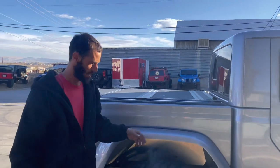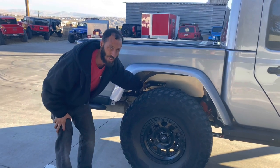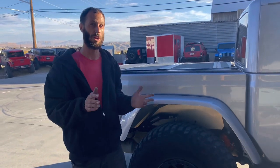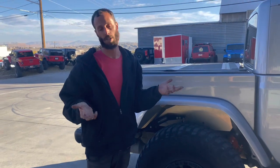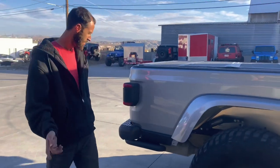Re-fixing that geometry helps keep the axle in a better line — both vertically and in how it handles potholes and bumps, so it rides well. Again with the 39s you can see the highline fender and the aluminum inner fenders. You also have what's called the Anti-Rock rear sway bar. In the front, the Rubicon in four-low lets you disconnect the sway bar — if you had no sway bars the vehicle would roll a lot. The Anti-Rock adds a little stiffness to the rear to compensate, and on the highway it drives extra tight at speed.